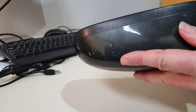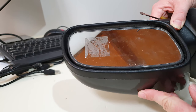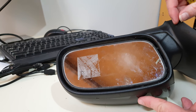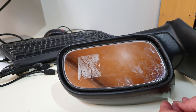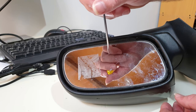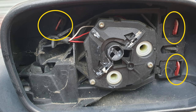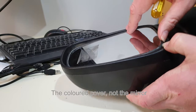Part of that is removing this colored section on the back of the new replacement wing mirror so I can put my old one on. Another video I found about replacing the wing mirror said there were two tabs on the back that you had to unclip to get the back off — in fact there are three: two over here and one in the back behind here.